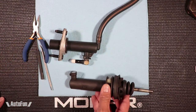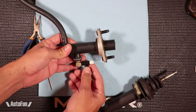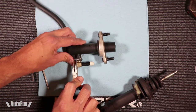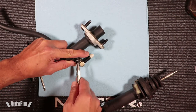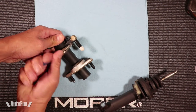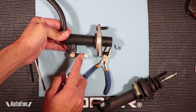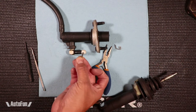There are no bleed screws. So this is how you would separate the system. The parts are connected by a plastic line, and that plastic line is held to the body with a very simple clip, which I'm going to pull right here. If I pull this cotter pin up and pull this out — once the clip has been removed, you can see that the line is held by a roll pin. That's the only thing holding that line in place. This is what the roll pin looks like.